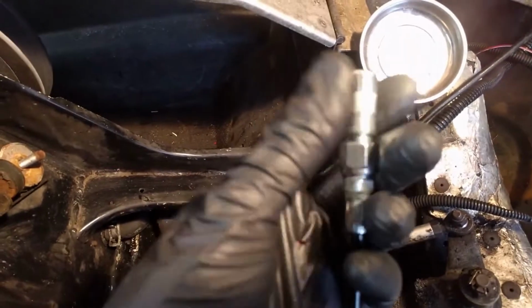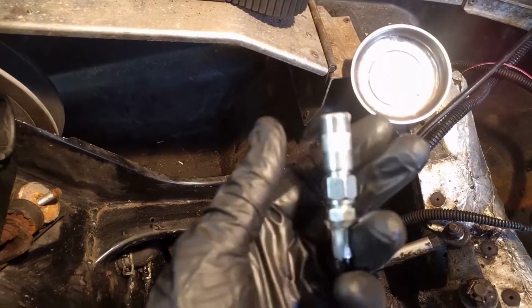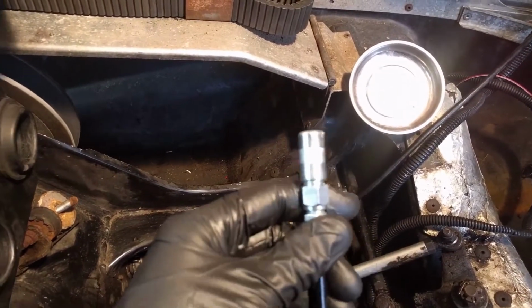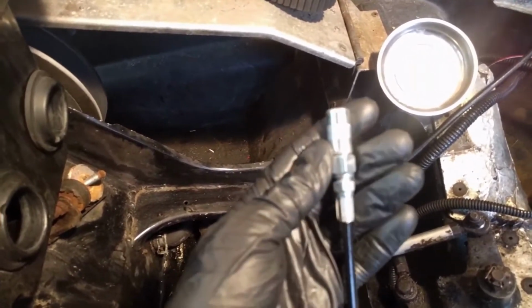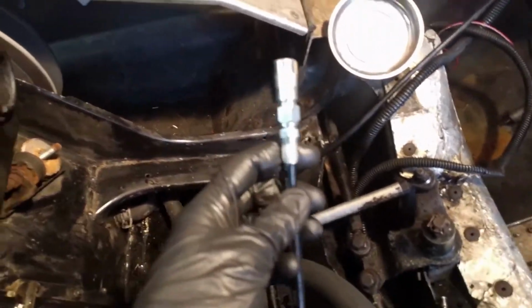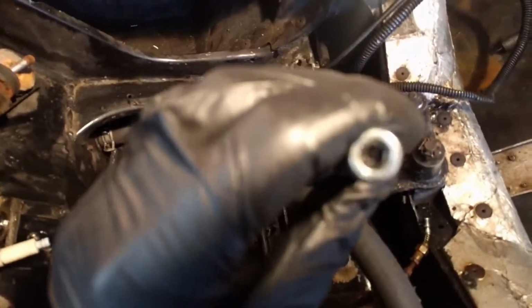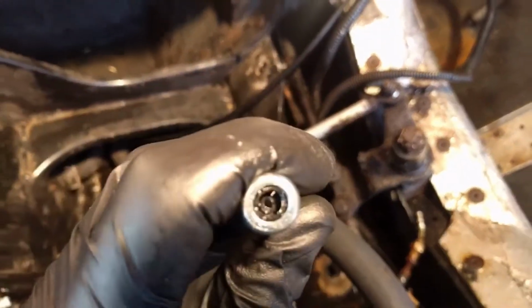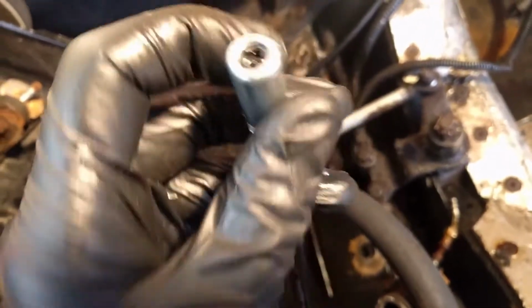So the grease gun has a threaded cylinder on the top. You basically want to unthread it, lefty, loosey a little bit, loosen it up, pop it onto your fitting, tighten it down. Now it's nice and tight. Pump the grease. When you're done, loosen it up a bit and pop it off. So I didn't do that, so I was kind of forcing the issue. There's a spring in here which kind of tightens and loosens a probably some clamping type mechanism in there. So anyways, just be aware of that if you have a similar grease gun.